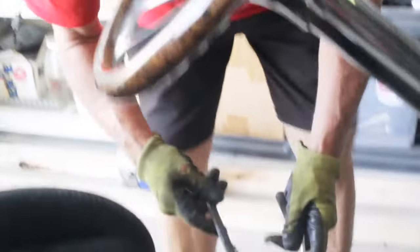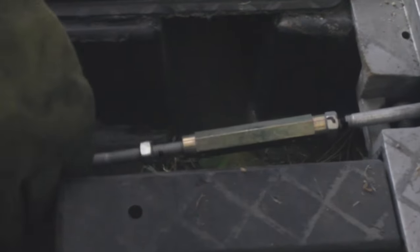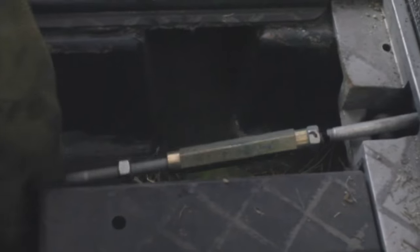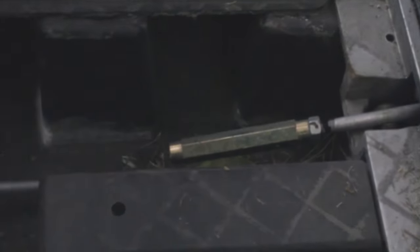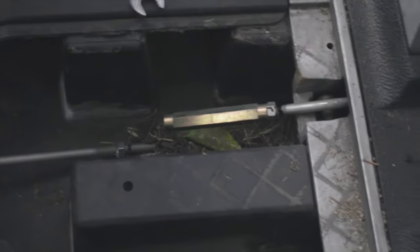Once you mark those, you take your 2 half-inch wrenches. One of these is left-handed threads, one of them's right-handed threads. So you're holding this one and you want to loosen the nut. On this one, I'm pulling the nut to me. I back that jam nut up. Now, we lucked out. This is loose. We're going to unscrew this. We didn't even have to touch this end, but we're going to unscrew this. That just loosened this up, so we can remove this assembly.